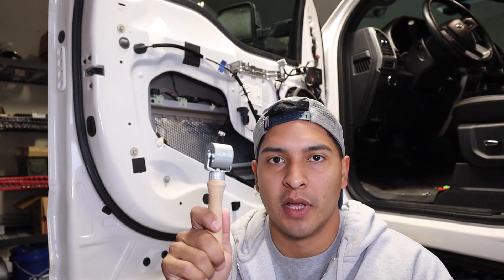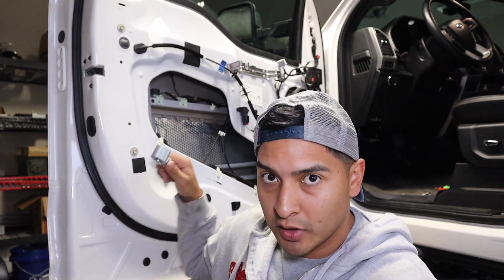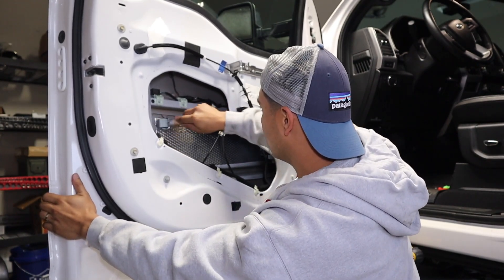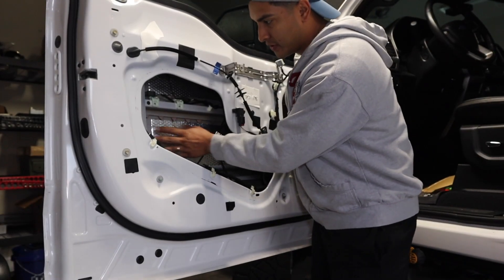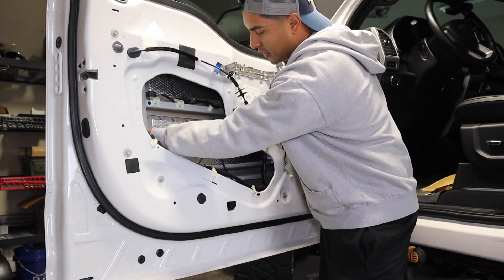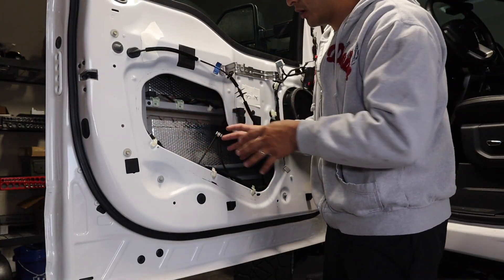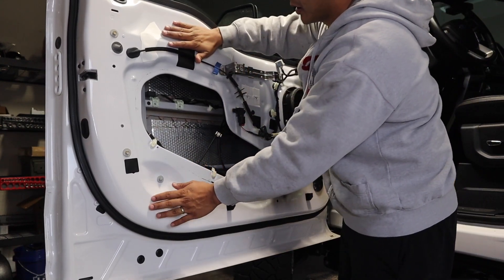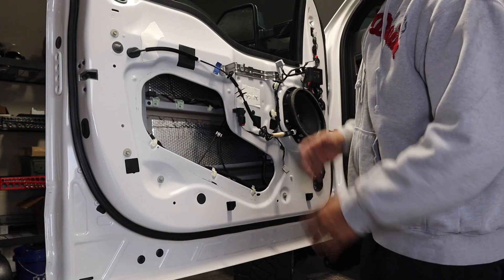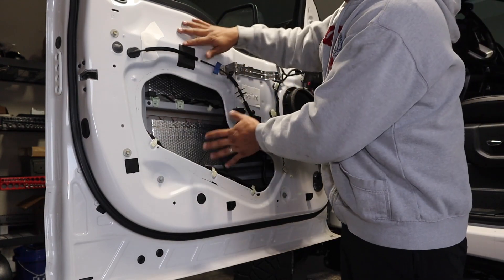It's always good to just wipe down the area before you lay on the mat. After you lay on the mat, go ahead and use this roller tool — I like to just roll it right on across. I finished installing some sound deadening mat on the inside of the door. You don't have to get a hundred percent coverage when installing this sound deadening mat because you're also going to put some on the front of the door panel. So that leads us to our next step — installing sound deadening mat on the front of the door.